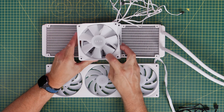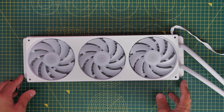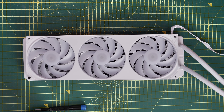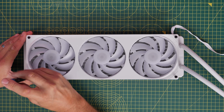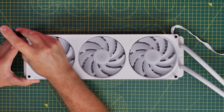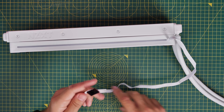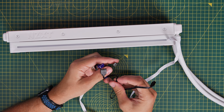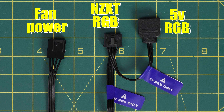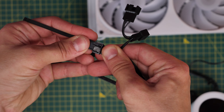Without the standard fans installed, we're going to install the single F360 fan instead. Same logic — make sure the wires are going to face in the right direction and that you're installing them in the right direction for airflow. For exhaust logic with a top-mounted radiator, put them with the blades facing that way, and you only need four screws in the four corners — much easier than standard fans. There's a single cable coming out of it as well, so in theory it's easier to wire. It comes with an adapter cable in the box — plug the standard flat connector in and it gives you three cables: a 5V RGB header for the motherboard, the proprietary NZXT RGB connector, and the fan power connector.